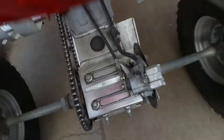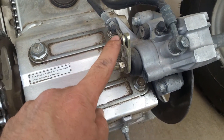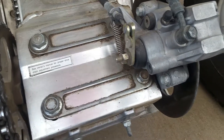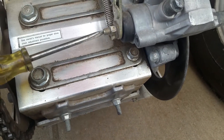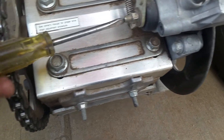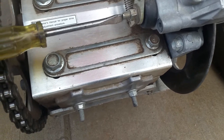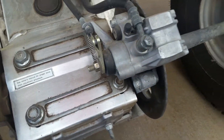...on the back side of the rear brake, you have this, which is where the cable connects. You loosen this, take a flathead screwdriver on the back side right here, and you screw it in until it gets hard, then back it off a little bit, tighten it up, and you're good to go.